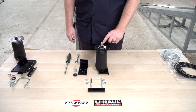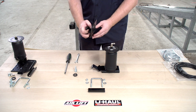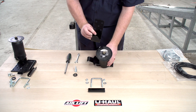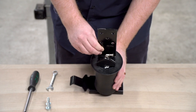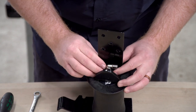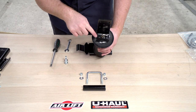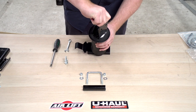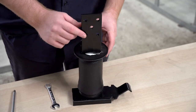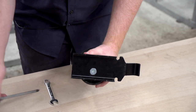Make sure that your fitting is pointed away from the tab on our spring bracket. Now take our second bracket that is attached to the frame of the vehicle and slide it over this fitting. Take our nylon jam nut, slide it over the fitting, and tighten it down. Once you have it in by hand, the tabs inside the bracket will allow you to twist and tighten it more. Since we left the bottom loose, we're able to put it back in the right place. Make sure your two brackets are parallel with each other, then go underneath and tighten that down.